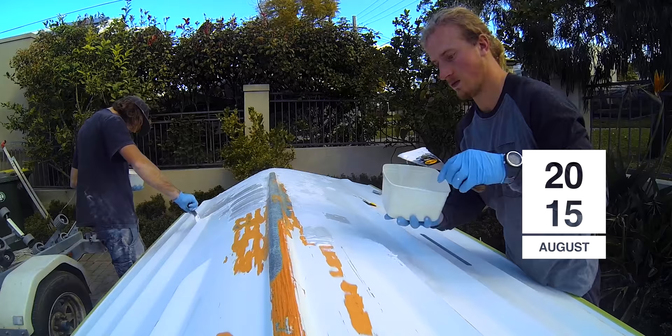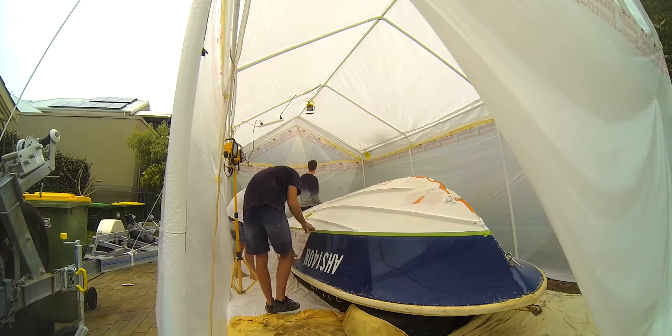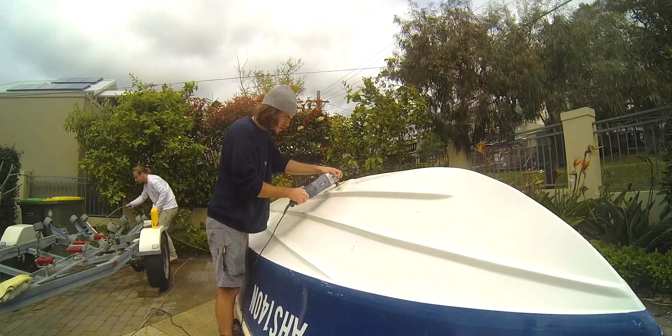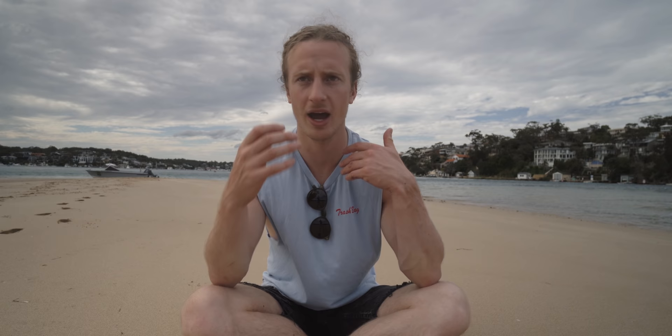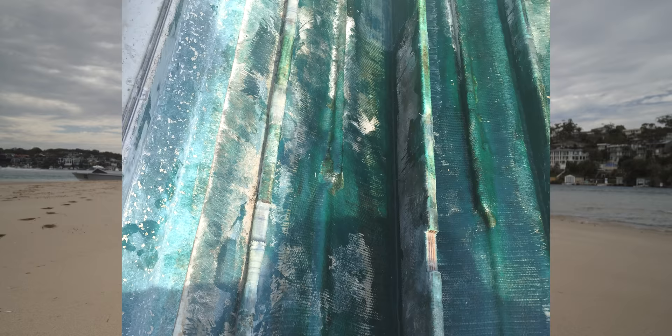We had to sand it back, fair it back, and bog it in. After we sanded up all that mess of that old boat, we built a tent around it in my front yard — which was the biggest eyesore. We got it ready to be sprayed, so we sprayed the bottom with gel coat with a thinner. I did most of this rebuild in the front yard of my house — parents were not happy — but my friends were there to help. I was working this out along the way, with no idea of the best approach, just trying to get it done reasonably well.